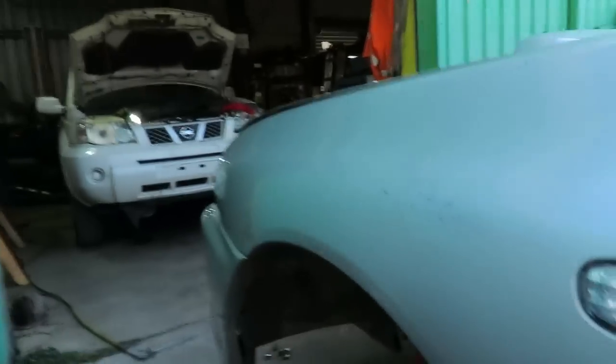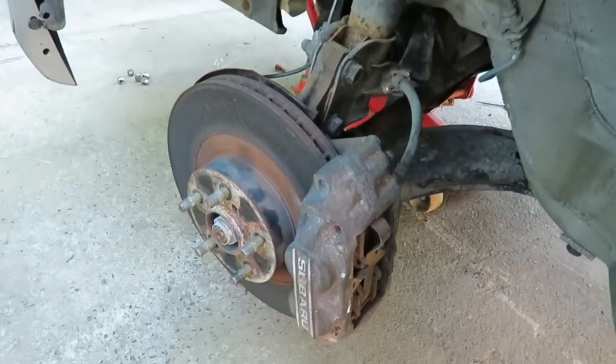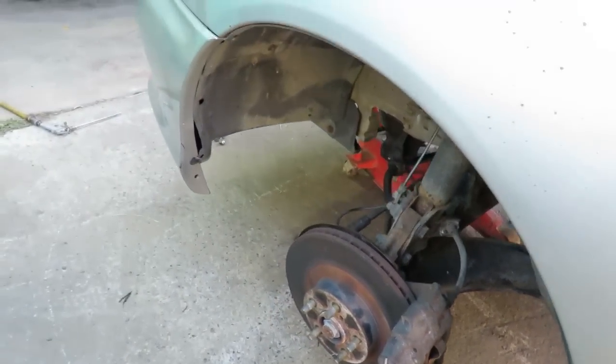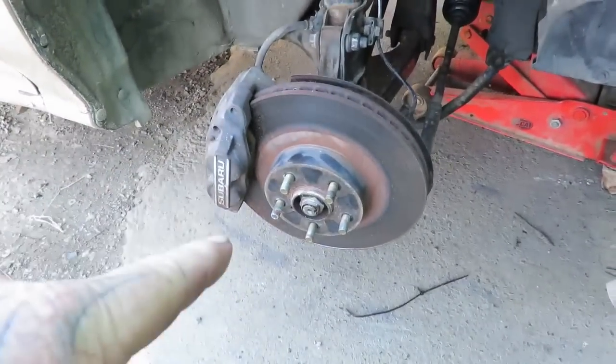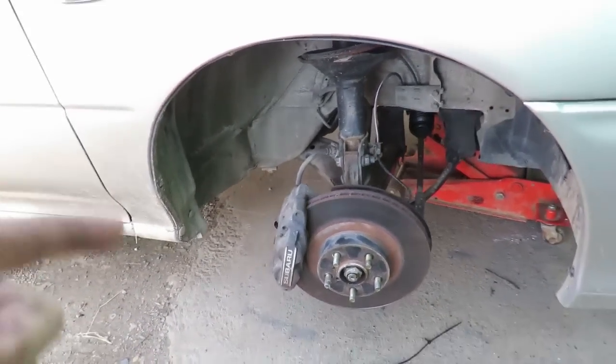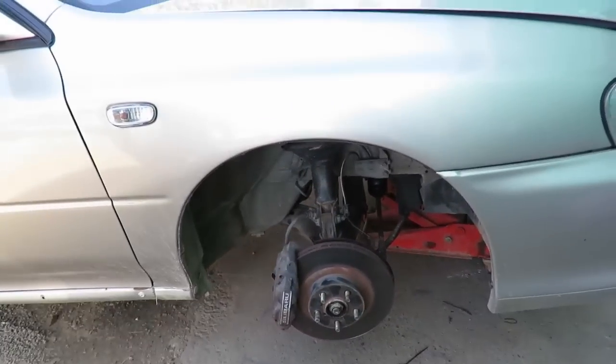It's really, really bad. But anyway, the other brake pads have turned up because when I ordered the discs, they sent the wrong ones. So got this jacked up, going to pull those discs off and put the new ones on. These ones have got the 2-spot calipers, the bigger ones. And they run the same pads as like a 240SX and Skyline, believe it or not. So they've turned up. So hopefully this thing today I'm gonna get some fuel while I'm out, and we will be able to drive it properly.